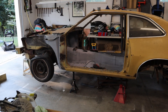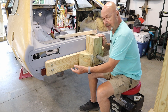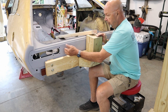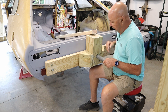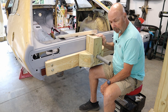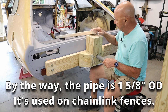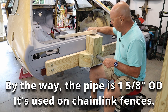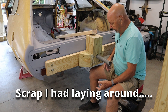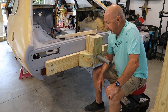At this point I have it jacked up on jack stands. I also went ahead and removed the rear end on it. I have the rear pivot point mounted now. I used a two by six and attached it to the car using the bumper mounting locations, and I had to put spacers under each end of the two by six to keep it from pulling in too tight and getting into the curved part of the car. To that I have a six by six mounted, notched to fit that two by six, and mounted with four three-eighths inch bolts. I also added a couple of angular pieces for rigidity. I added a two by four screwed to the top to prevent this thing from wanting to roll backwards and forwards. It's fairly light — I can pick it up with basically two hands, so I probably overkilled a lot of this, but that's what the rear mount looks like.